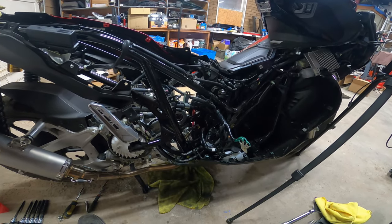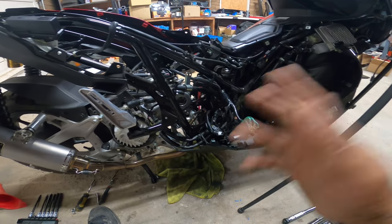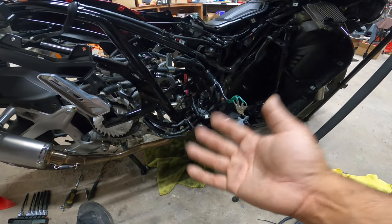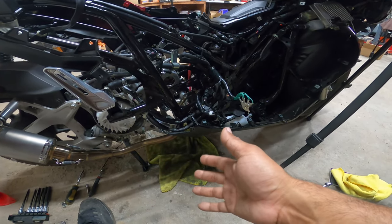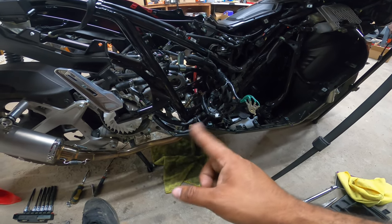For your torque specifications, again, look at your manual that I provided in the description, so that way you guys get it all going. Once you look at your manual and everything matches, torque everything to spec, put it all back together in reverse, fill it with coolant, let it idle, let the thermostat open, make sure you don't hear any weird funky noises.